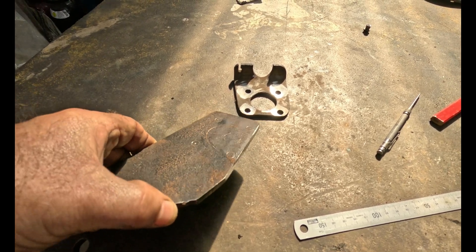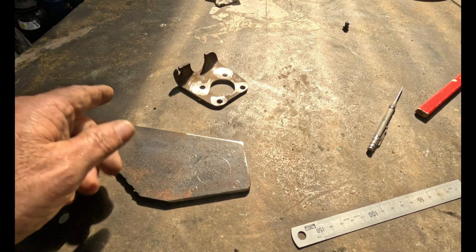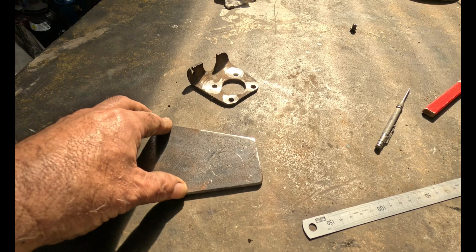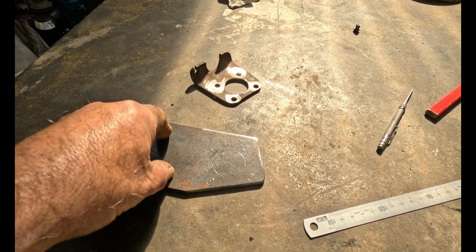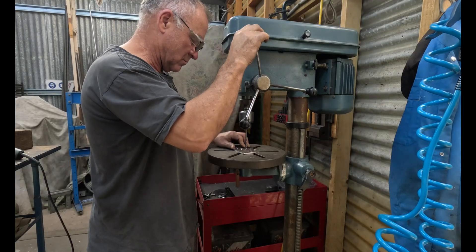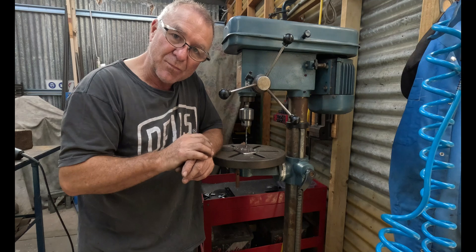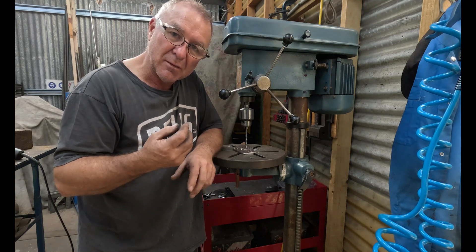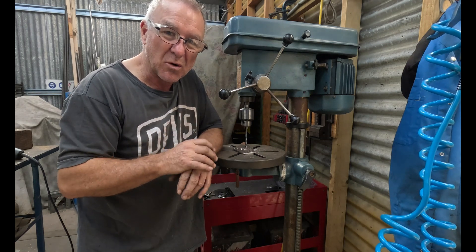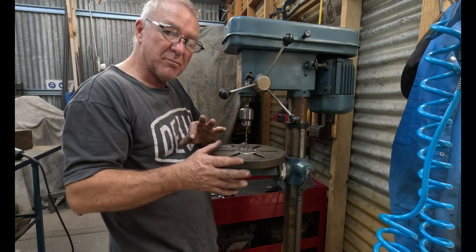I've got that marked out — obviously using this as a template. It's angled up and obviously this will be trimmed back. I'll get all this drilled out and mounted back onto the brake backing plate, then fit it up. What I'm doing is drilling out the rivet holes here, but I'm drilling them out smaller. The reason for that is so I can pick up on the backing plate and get them perfectly aligned, because I am going to re-rivet them — I'll make rivets. You've got to have the holes pretty spot on between the two pieces when you rivet.